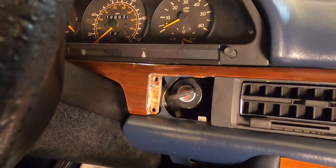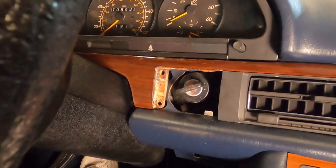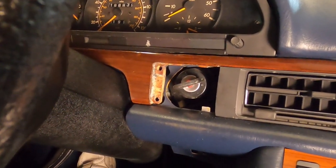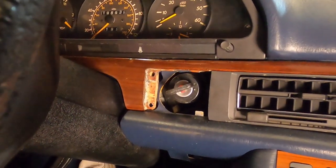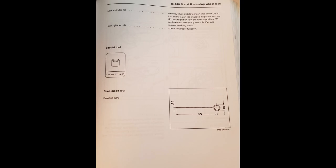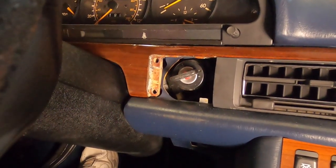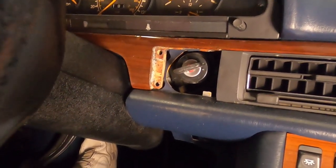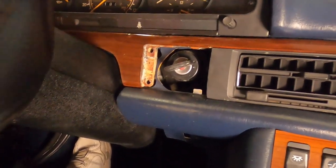The tools used to extract the cylinder lock on both versions of the 126 are a little bit different. On cars up to August of 1989, you're going to use a single little pick tool, and I'll put a picture of that right here. On cars from September 1989 going forward — again, this is for 126 cars — you're going to have a doubled-up or V-pronged tool. It won't be a singular tool, and I'll put a picture of that right here.